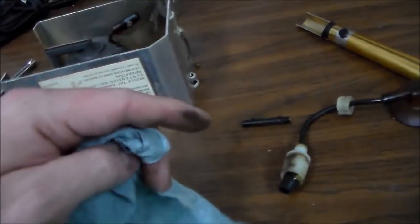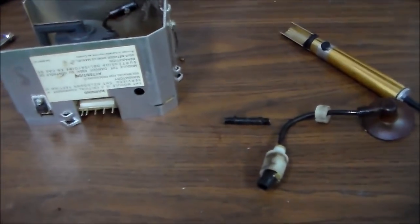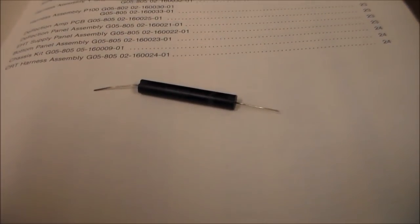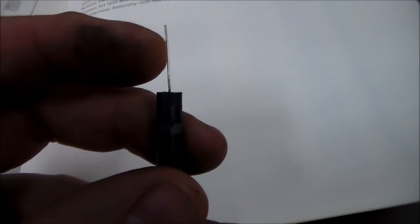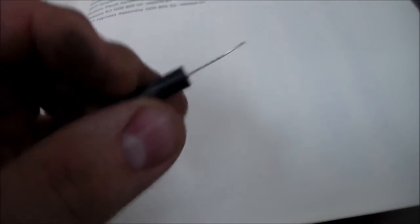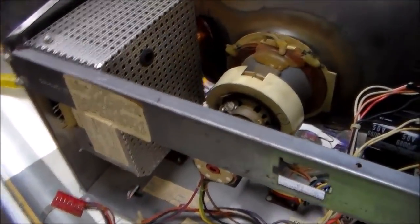Or we may get it all ready, put it back in, and it's still too big and just needs adjusted. But I actually saw it smaller and then it got real big, so that's classic blooming syndrome symptoms. I looked in the manual — everything which, remember, was in the bottom of the cabinet thankfully — and everything was correct. I went ahead and replaced that capacitor, got the boot clean, got the other side clean, and I've got this new diode. I'm going to cut the end a little bit, make it about half that size, curl it up a little bit, and push it into the holders. Here's our old one that we removed — it's pretty funky.